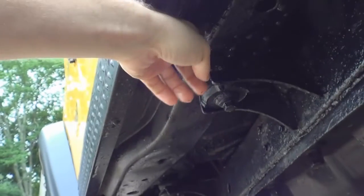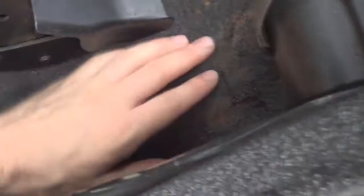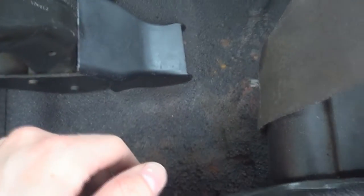But the rust is not eliminated because I have all this body rot up here, and where my body mounts are, not looking too good either. I'm not going to go too deep in all this stuff right now, but believe me, it's not too good here. And if we go ahead and look inside, you can see right behind the driver's seat, it cracked. The day after I got it welded, this finally cracked open on me. This had been rust coming through the bed liner here for a long time now. And it finally went ahead and cracked on me, so it's not a big deal right now, but I can't do anything about this like I've done in the past, where I've done little patch welds like that, or the patch weld in the back there that have held very well. This is too close to where the roll bar mounts to the tub, and where my driver's seat is. So for now, I'm just keeping an eye on it. If it gets really bad, I'll have to take action.